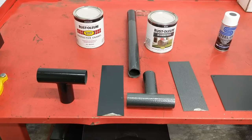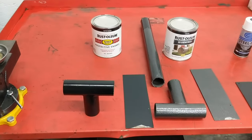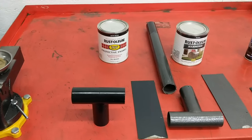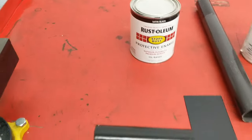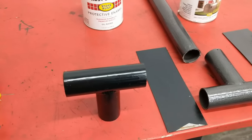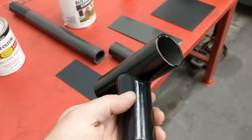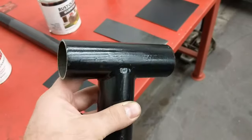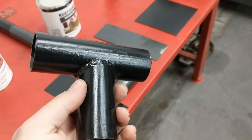I wanted to try a new product, but first I want to show you a couple products that customers of mine have used in the past. These are the two products most commonly used for coating roll bars, roll cages, and suspension components after fabrication. The first one is black Rust-Oleum satin - it comes in a can, it's oil-based, gives a decent shine. That's what Steve here at Scram Speed has on his roll cage. I did a test sample - this is only one coat, it lays out better with two, but you can see how many imperfections show through.